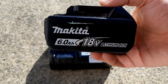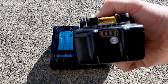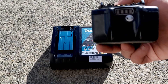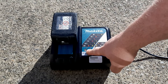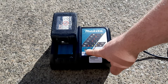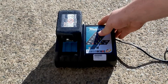Here I have a Makita 18V LXT Lithium Ion battery that doesn't work very well at the moment. If you press the button, it's got one flashing light on the battery indicator. If you put it in the charger, it will not charge. It'll start off as if it's going to charge, and then the red light will start to flash instead of a solid red light. So that means there's a problem.